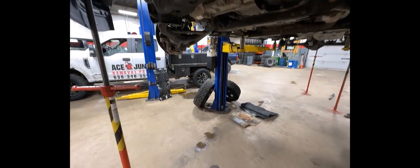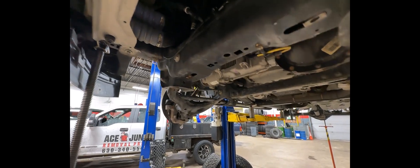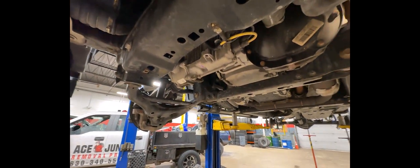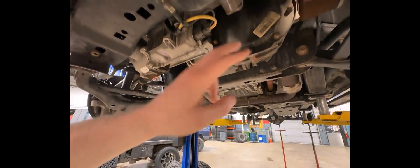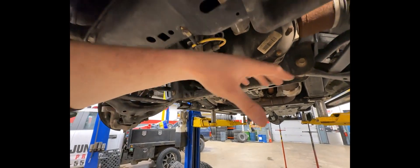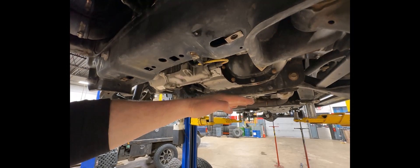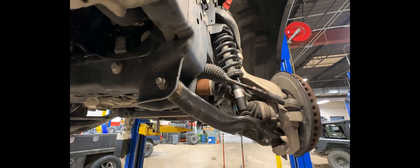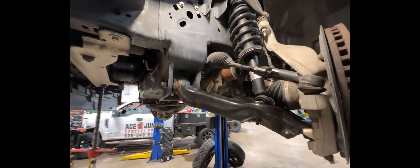When you go with a suspension lift, coming underneath the vehicle — you have your differential, your steering rack, and this cross member. With an actual suspension lift, you cut the tabs right here and you get new cross members that bolt up underneath. This drops your differential down and maintains those factory steering angles, which is important for overall ride quality and how quickly you wear and tear on the joints.